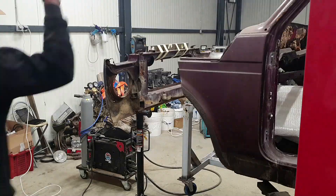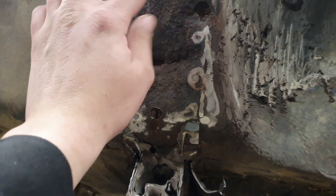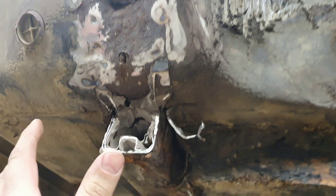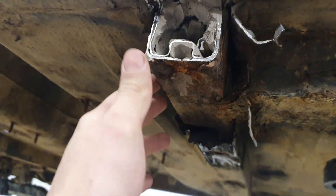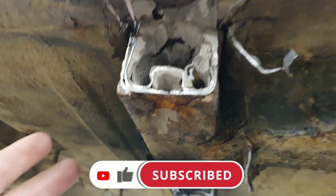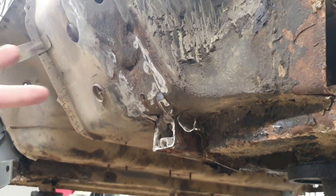I was hoping that everything would work really well, but we have some pretty big problems. As you can see, I need to cut this and weld a new piece — this is all rusted. But that's really not my main concern here. What I found is that someone put some sort of body kit or something into the chassis rail, and the chassis rail is completely detached here. This is really bad and I need to fix all of this.